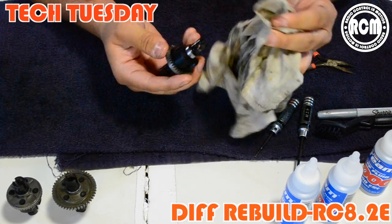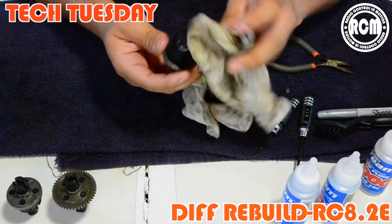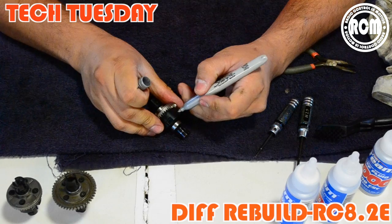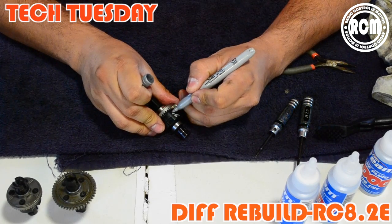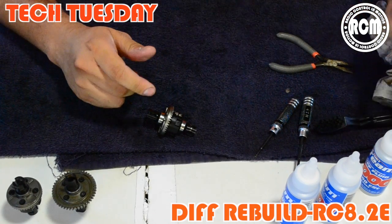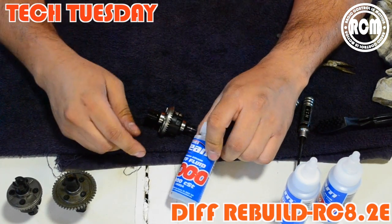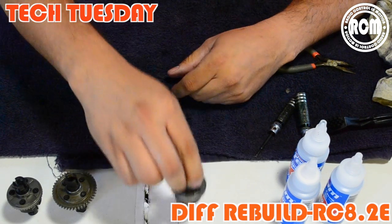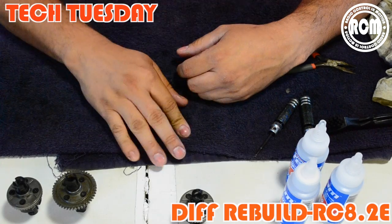If you want to do it just for the next time you go to rebuild your diff, you know what fluid you have. Right here on the side we can write 7K. That way we know that in this diff there's 7,000 weight diff oil or diff fluid. So now that we have that one, we can go ahead and do the rest just how we did them.